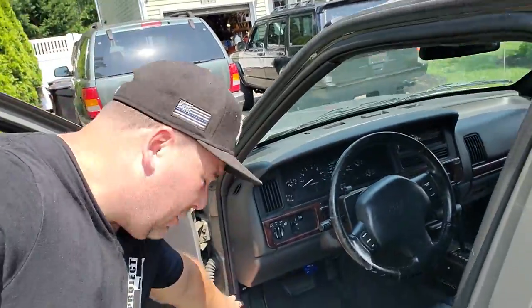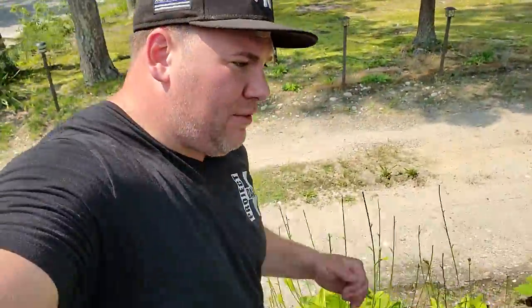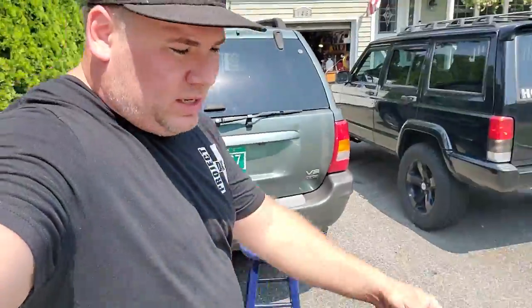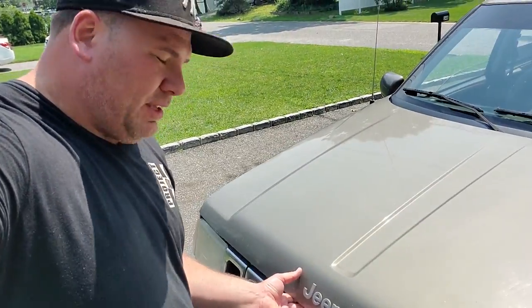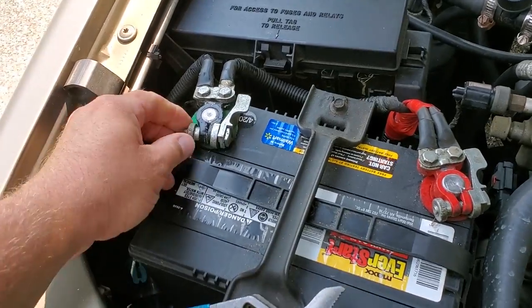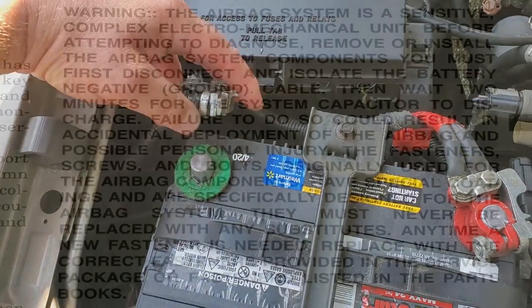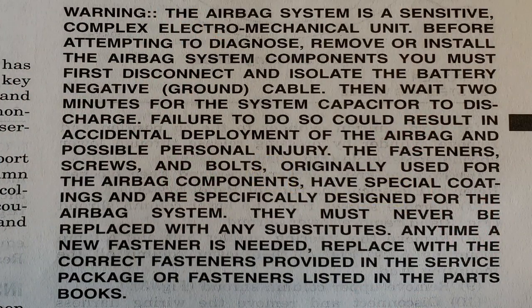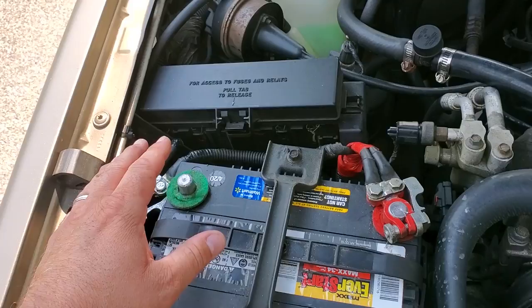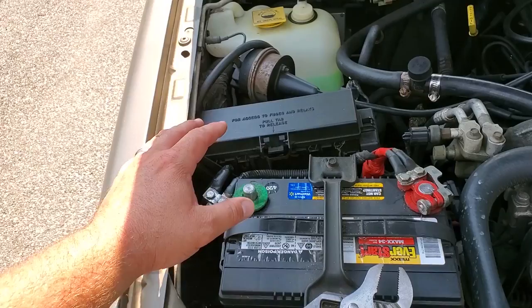All right, first thing you're going to do — this is the real step one. What you're going to do is pop the hood. Because every time you work on an airbag you're going to want to disconnect the negative terminal of the battery. This way you don't mess around and pop your airbag off in your face. It is very important — disconnect the negative battery terminal. Safety first. I am serious guys, you want to do this. It even says so in the FSM: isolate the negative battery terminal, otherwise your airbag could pop you in the face. You're going to have to redo your radio presets, but that's better than ruining your airbag.